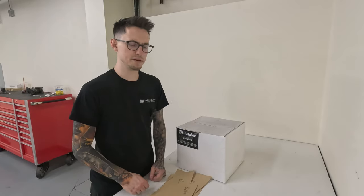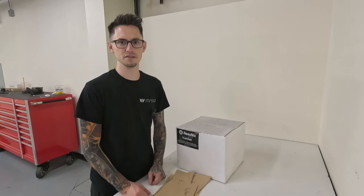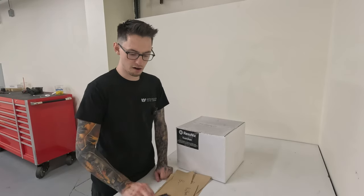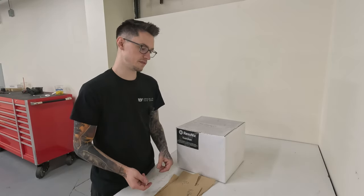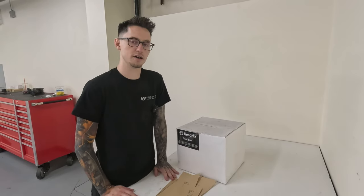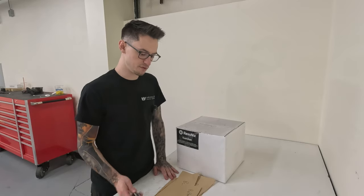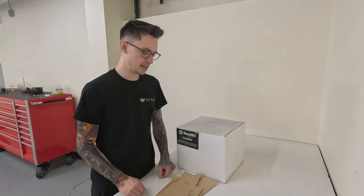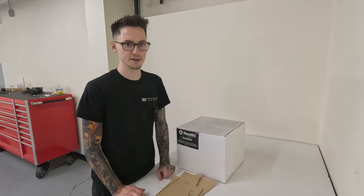I like to put down a piece of cardboard or a piece of scrap wood, like MDF or something, underneath it, so I'm not cutting into my table and I have a nice smooth sacrificial surface that I can cut into and make sure I get a clean cut straight through it. If you find your razor starting to grip the melamine or start tearing it, it's time to change the razor. It's not sharp enough.